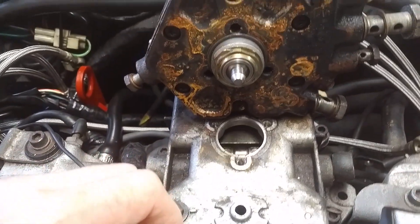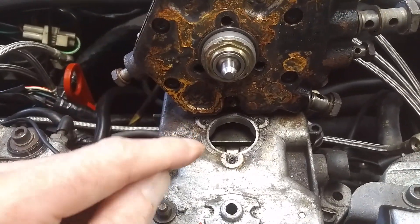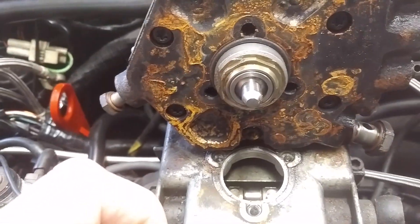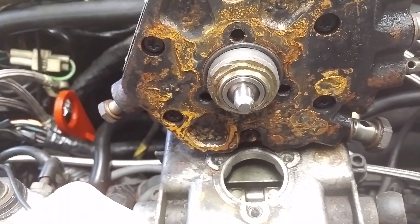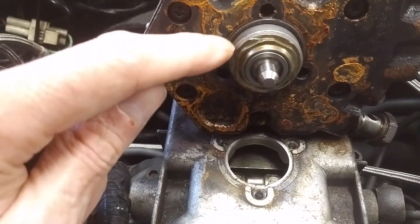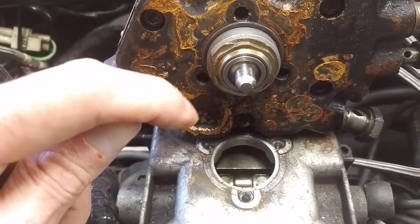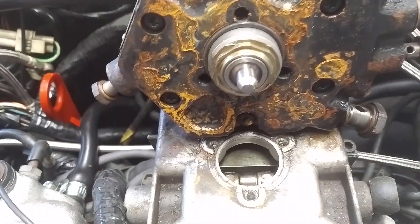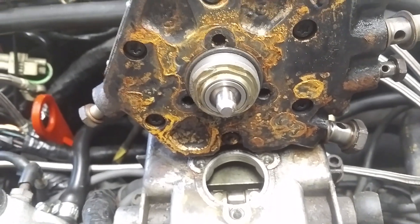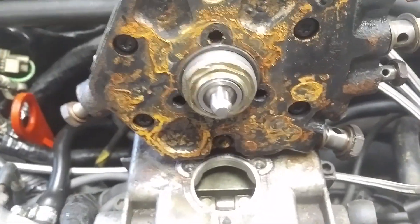You can see how that just dropped in on its own there. That fit is extremely tight — it's metal on metal — and it is so perfect that petrol can't get past it, or at least it gets past it at a very tiny rate, not enough to affect the fueling of the engine. What can happen on badly rebuilt metering heads is you can get a leak between these two pieces and actually get fuel dripping into the air intake — an internal leak — and you'll never know other than the fact that you can never get the fueling right. That's a really unusual failure; I've seen it once and heard about it once.